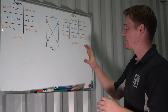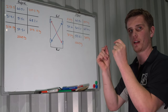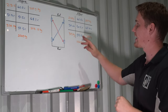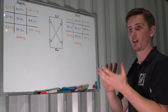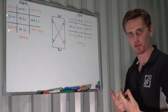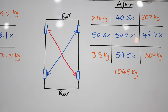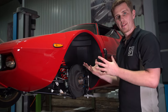The call we made on this car was to get the rear tires as close as possible and accept a little more imbalance at the front axle, giving a much more even overall balance. The other benefit is that our cross weight is now much more even, so through lefts and rights the car is going to feel a lot more planted and reliable to the driver - feeling the same in both directions. Before, we ran the risk of the car feeling quite different through corners.